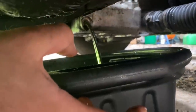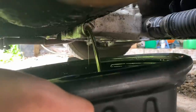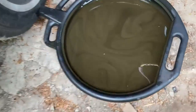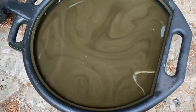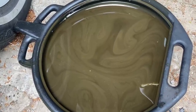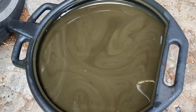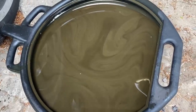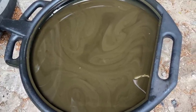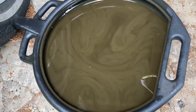That's what's so great about this car — you actually don't need to jack it up to change the oil, and you can get the filter from up top as well. You can just hear how thin that stuff is pouring out. I switched to a different pan for the last of the drain and you can see this is the first stuff that came out — just look at how much moisture was left in that oil. There was a lot of water contamination in the old oil. I've been running just for a week now a thin 10W30 flushing oil to try and get all of this stuff out, and I haven't lost any coolant, so there's no new water getting in — it's just clearing out the old contamination. That's also why I'm doing the engine flush — I would have done that even without the compression issue on cylinder two.